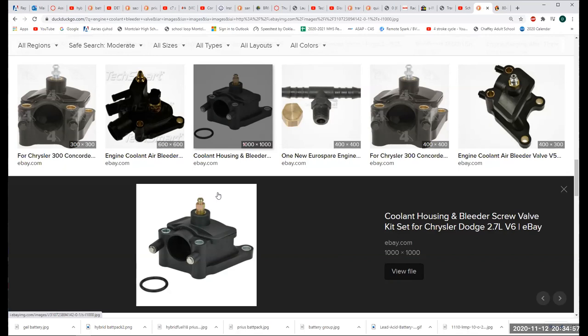And the problem is, on the cooling system, a lot of people don't understand this question about bleeding cooling systems. So a lot of times that valve won't have been moved for like 15 years. And if you're not careful, you're going to strip that thing or break it off or do a million bad things that you don't want to do. In fact, I'm going to suggest, before you loosen up that valve, come in there with some penetrating spray, like Liquid Wrench or whatever. Just increase the odds in your favor.